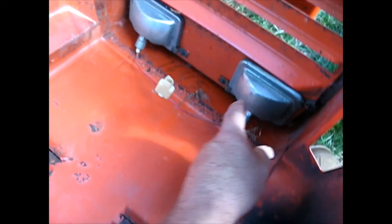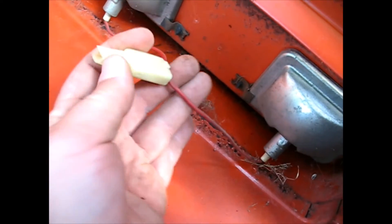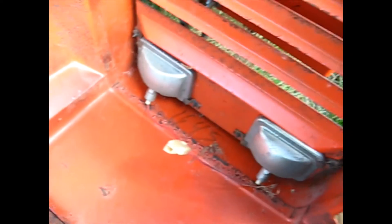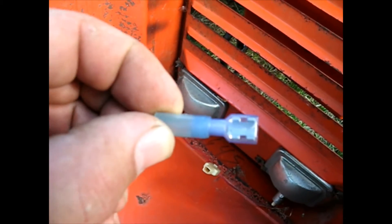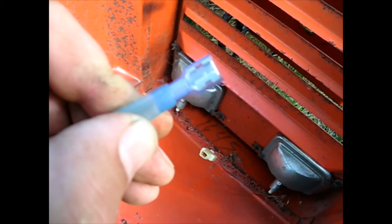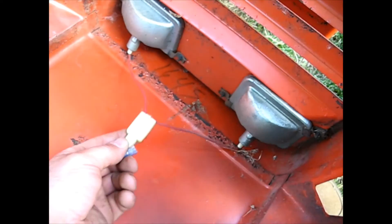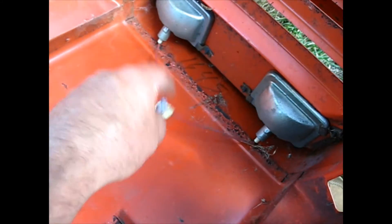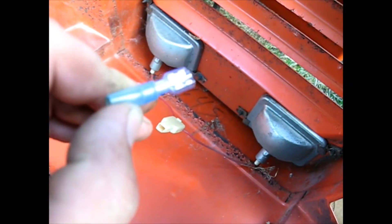Let's start with the headlights. They're grounded through just the ground — it just needs a power wire. Mine's a little deformed apparently. There's a male terminal way inside there, so what I've got is one of these female terminals. I'll just have to whittle the plastic off the very end part because it won't quite fit in there, and I don't want to whittle away any more of that original plug because it's a good protector — it's hard plastic, whereas this is just kind of phony stuff. So I'm going to chip away at that and then it should fit in there.